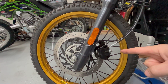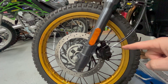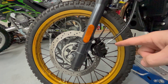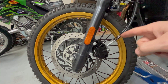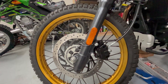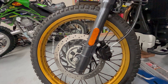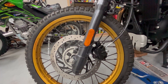So why is this one reported to be a lot better? I measured some things. Everything is the same except probably the most important thing: the pistons on the Bybre caliper are 26 millimeter, and the pistons on the Harley caliper are 28 millimeter. You can work out using Pi how much more clamping power those two pistons have. The Street 750 is probably a way heavier bike than the Royal Enfield Himalayan, so it was logical for them to use a better brake. Fortunately, that's an amazing brake for a 400-pound Himalayan.